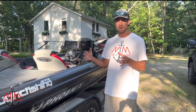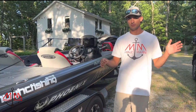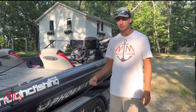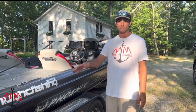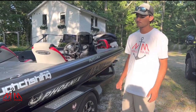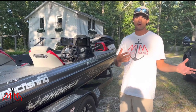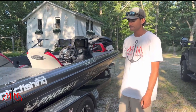We also want to make sure our lights are working. Luckily on my Ford truck and some other vehicles, it will tell you if a light isn't working — it'll show on the display if your left blinker isn't working or whatever. Plug it in, throw the hazards on, come back and make sure everything is lit up — running lights, amber lights, and the back lights. If it's not working, I usually jiggle the plug; sometimes that works. Sometimes you've blown a fuse in your truck, or the ground isn't right.